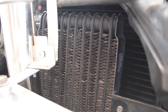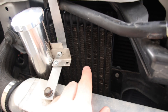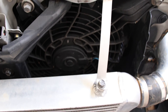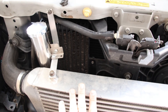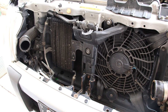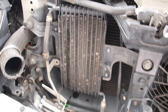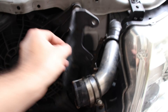That's the standard cooler right there — it looks a bit average and is probably due for replacement, but it should be okay. I'm going to mount the new cooler right here so it goes all the way down from the top to the bottom and then back to the transmission. With the intercooler off, you get a better view of what the standard cooler looks like. We're going to place the new one here — there's normally a cover over it, so just take that off.